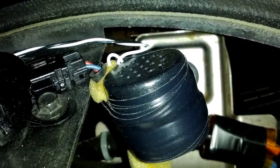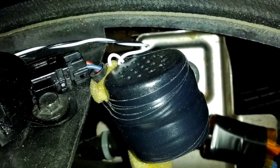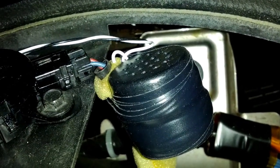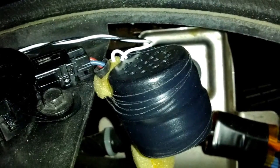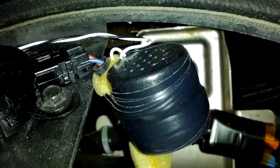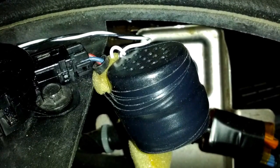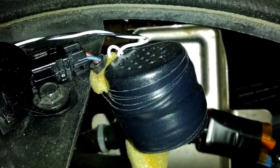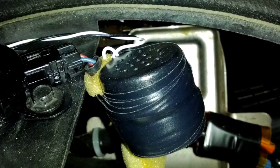I have them back-to-back so they're firing upwards and downwards, and they're wired in series to give you approximately 200 ohms. It doesn't appear that the Nissan circuitry cares — I was afraid the resistance might be too high since the original OEM speakers are 50 ohms.